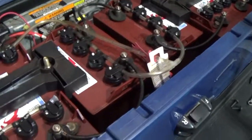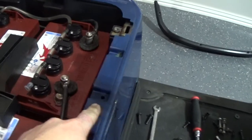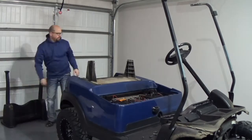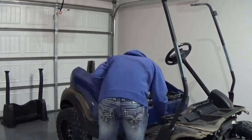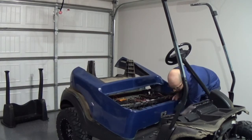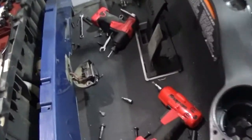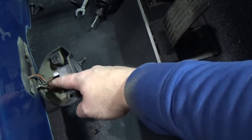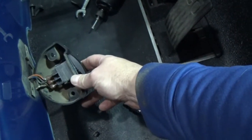To remove the rear body, you'll remove the four screws from around the corner of the battery compartment, two 10-millimeter bolts on each side, two more 10-millimeter bolts on each side here, and two long 8-millimeter bolts on both sides of the sweater basket. You'll also need to remove the forward and reverse lever — this is an electric cart — and note the sequence of how the wires are plugged in for reassembly.